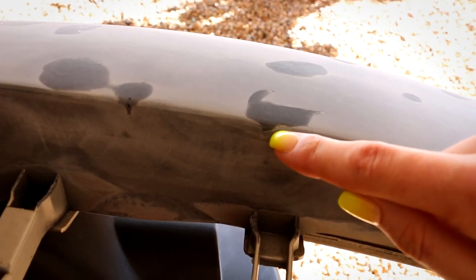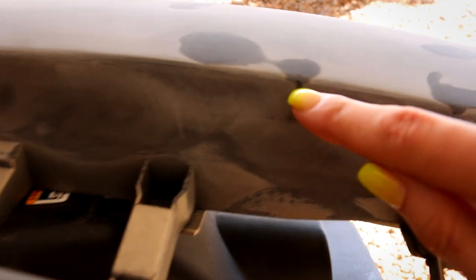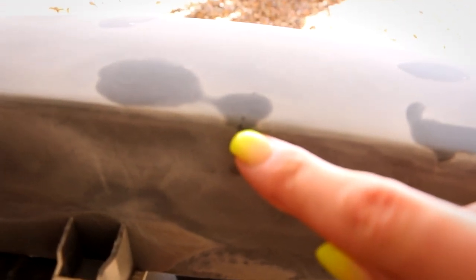I'm done — kind of. There's one tiny little spot that I technically should probably put some more filler on and re-sand. I'm really OCD so I'm probably gonna do it. Right here there's a slight little low spot. And then right there, I might sand the primer after with like 480 or 600 or something, but I'm not gonna go any higher than that because I'm gonna be vinyl wrapping it. I'm gonna get all the plastic taken care of now.